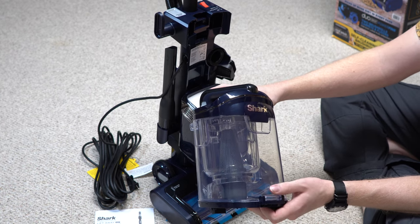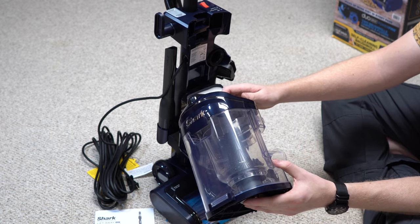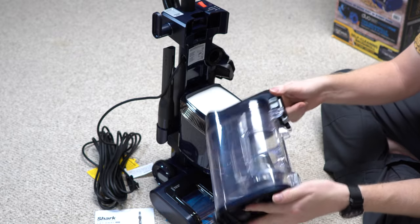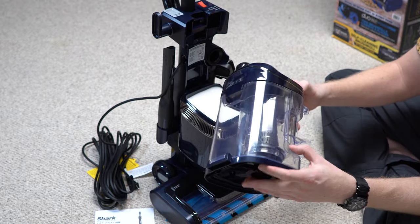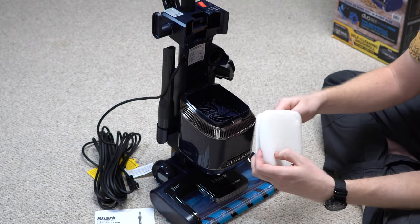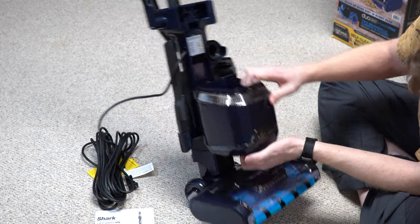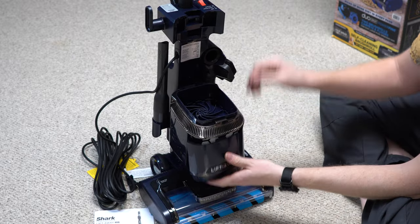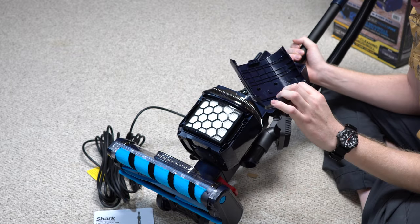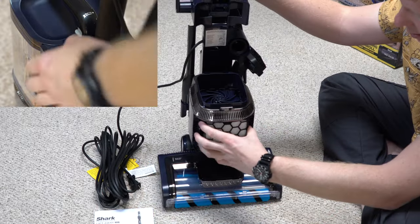Generally, if we're going to go bagless, say 2 to 4 seems to be the magic number. When you get up into like 25, that didn't work for them, and it didn't work for Dyson either. So that's why they've gone to this more premium cyclone. This also allows for a little bit more airflow at the beginning of use. Now we have 2 washable filters as per the usual arrangement. And then there is another HEPA filter, if we remember. Man, that's sneaky. I don't think any customers are ever going to know that's there. In previous years, this has been clear, or at least obvious, but now it's hidden.